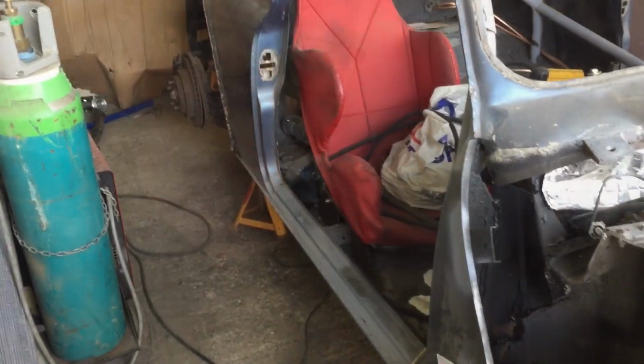Day 62, race car log. Seems like there are some prop shaft differences between different Subarus. The middle bearing has a carrier on it. The prop shaft I got with the engine bolted up too high, and it actually rubbed on the subframe. So I've had to make some spacers and some longer bolts to bring it down a bit, because that's what it looks like it does on the other one. We'll just have to go from there. Note taken. Okie dokie.